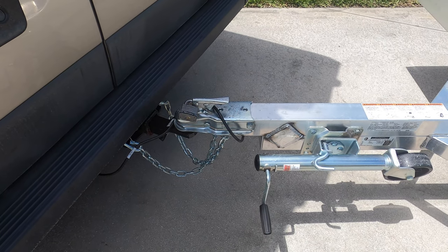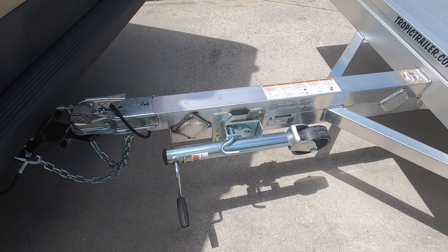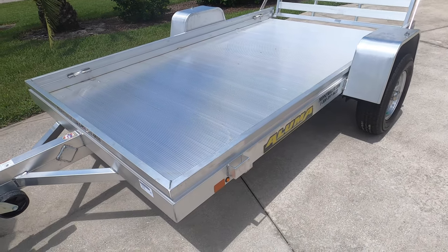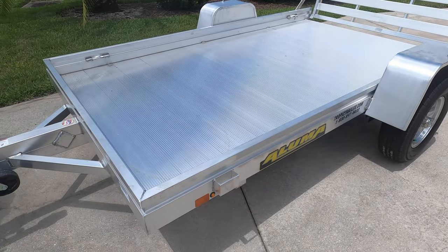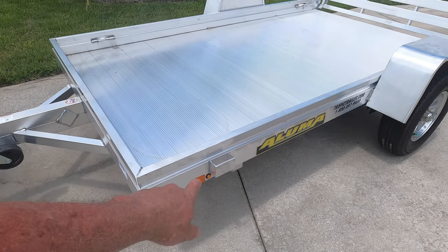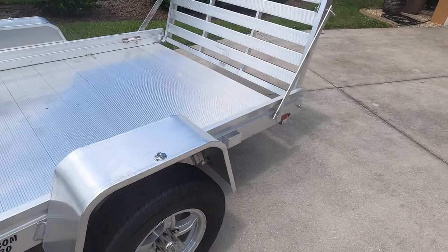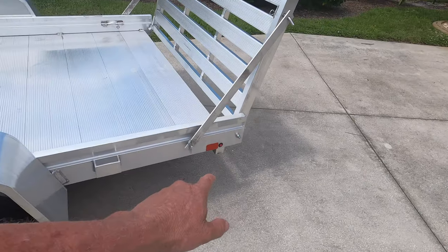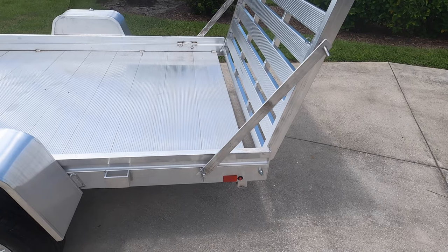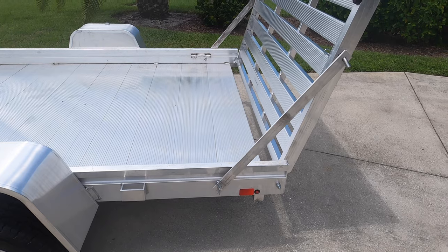This particular Aluma trailer has a two-inch hitch with a swivel 800-pound rated jack stand. One of the great features about this trailer is it's been wired with LED lighting. They have side markers just in front of the stake pocket, side markers on top of the fender wells, and a side marker on the back that changes from yellow to red in the rear, with standard LED lights in the back. This is just a phenomenally great feature for this trailer.